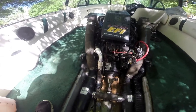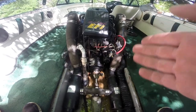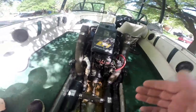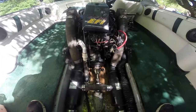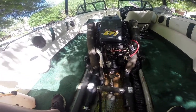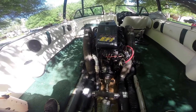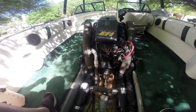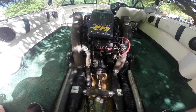Before we can do that, there's a few things we really got to mark off. We got to mark off where the transmission mounts to the drive shaft so we can put it back together and it will be balanced. Take a look and measure all of the angles — the engine angle, the transmission angle, and the drive shaft angle — in order to make sure we put everything back the way it's supposed to be. And then, hopefully this weekend when the parts come in, we will do a full transmission rebuild. I'm also going to replace the transmission oil cooler. There's not a whole lot of stuff inside this transmission, but those are usually famous last words.